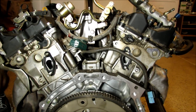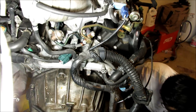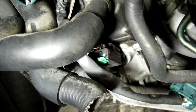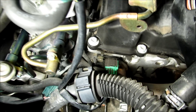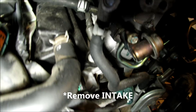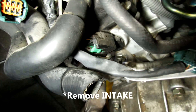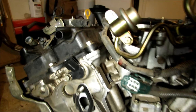Even though I showed you where the cam sensors are, here's exactly what it'll look like on the rear motor on the backside. That little green one right there is the angled one on the driver's side, and then the other bright green one is right there — that's the other cam sensor. With the plenum and everything attached, that's what it'll look like. You're able to reach this one with your hand from behind, but this one's a little hard — you kind of have to remove the throttle body to be able to gain access to it because it's really hard to get to.